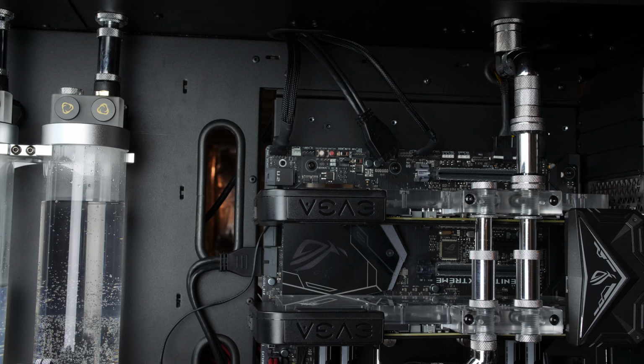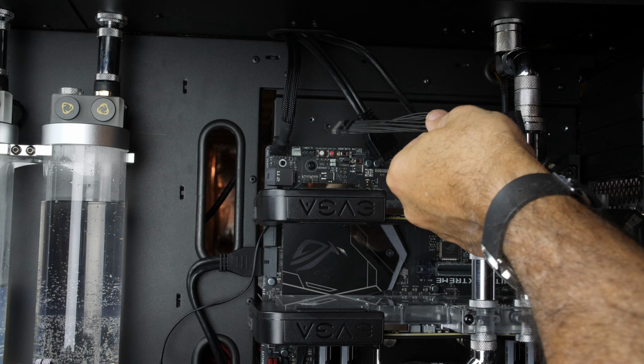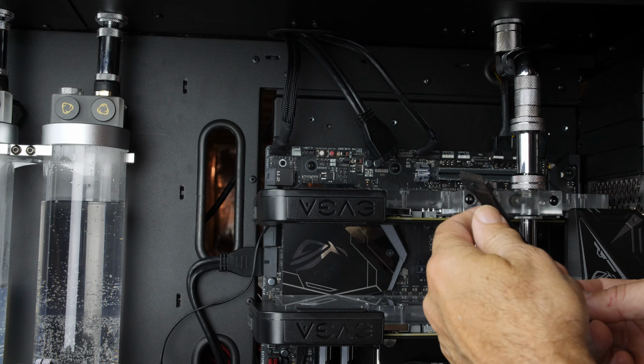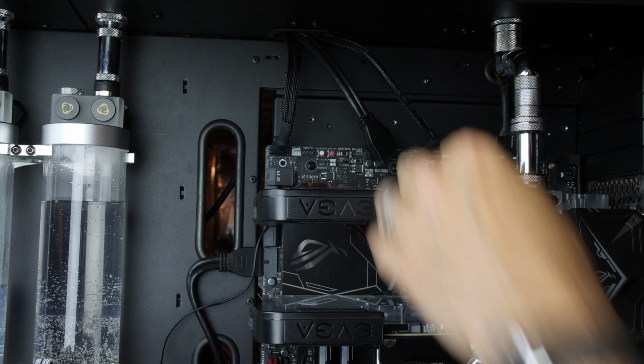So anyway, the purpose of this little segment here is to show you this cable, and like I said, it's a USB 3.0 20 pin header male-female extension. And you can get it on Newegg. I'm going to go ahead and make sure the connections work here, or that they plug up. I noticed there is one pin missing here. I'm assuming that that's normal. And yeah, there's a pin missing also in the headers down there, so it makes sense.